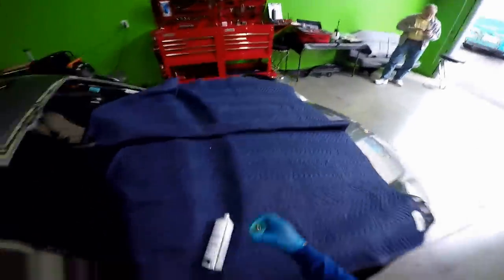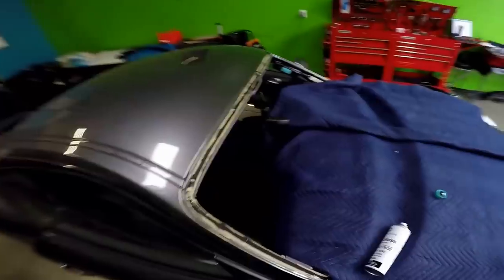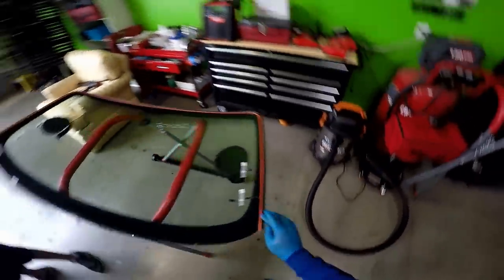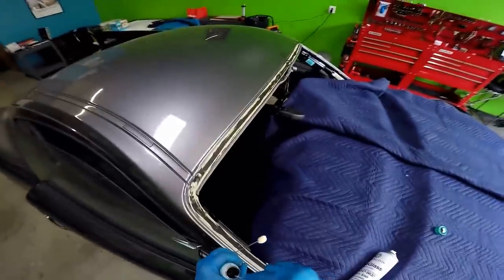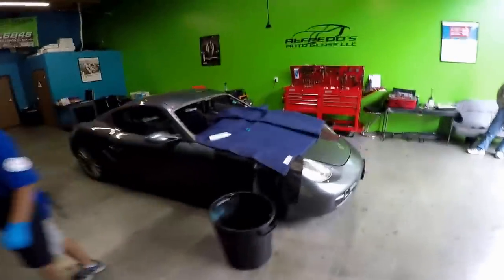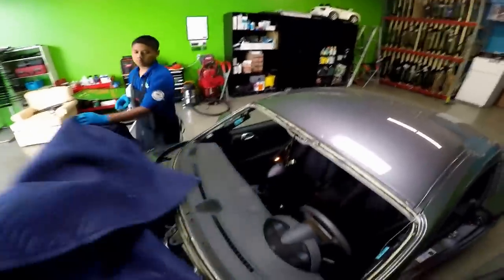As you can see, the glass, before we started the job, we prepped it, made sure that everything's correctly, that everything works. When I say that everything works, I mean that these lines, the connectors are not ripped. As you can see, this molding sits flush with the vehicle. So a good thing to do to know how much primer I'm able to apply, let's do a set over the molding. It's not going to compromise my bonding surface because there's that molding sticking out.